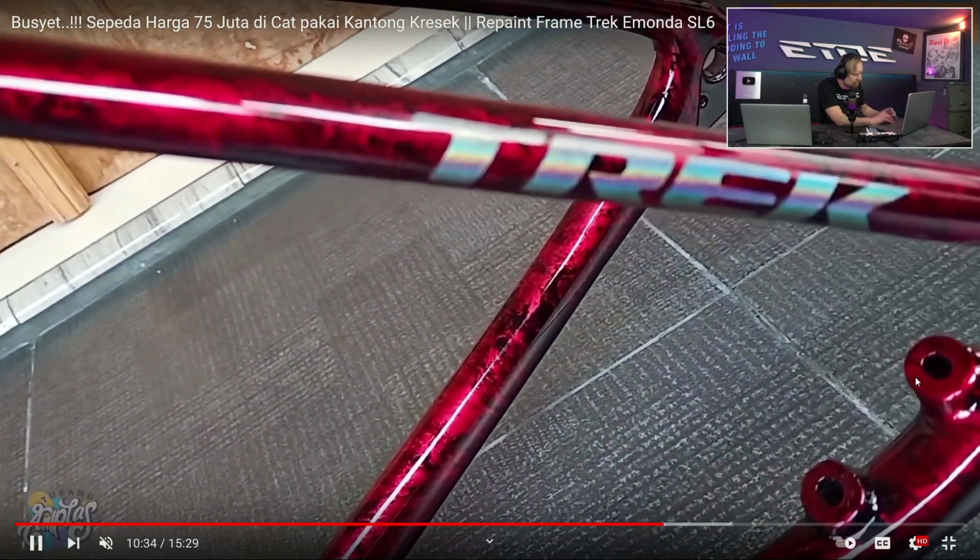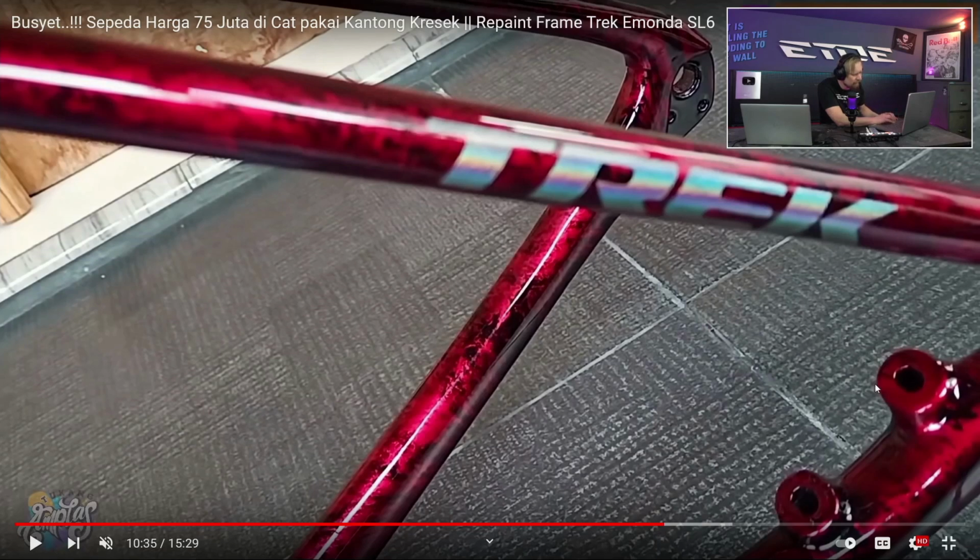Here again, can you see that? These sockets are painted. Here you can see it. So please, please, please don't paint the sockets for the brake mounts. It's a safety risk. If you paint them, the brakes won't fit well, and it's a risk that they can get loose. Factory frames are never painted in these areas. They are masked, and that's what I recommend. So please mask these areas. I mask these areas every time. So take your 5 minutes and please do the masking of the sockets for the brakes.